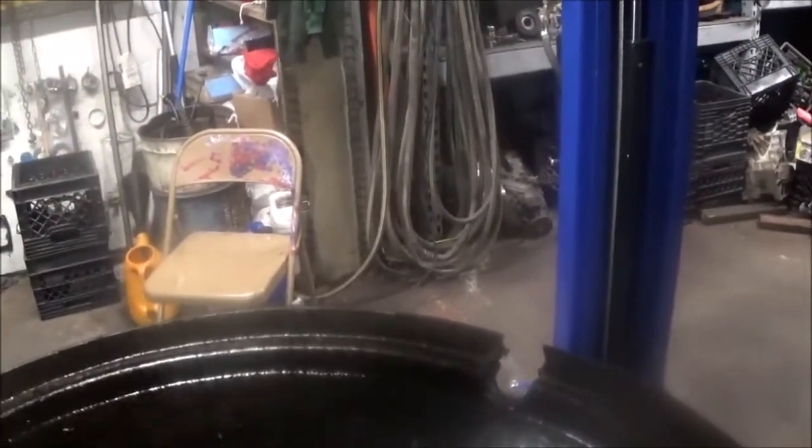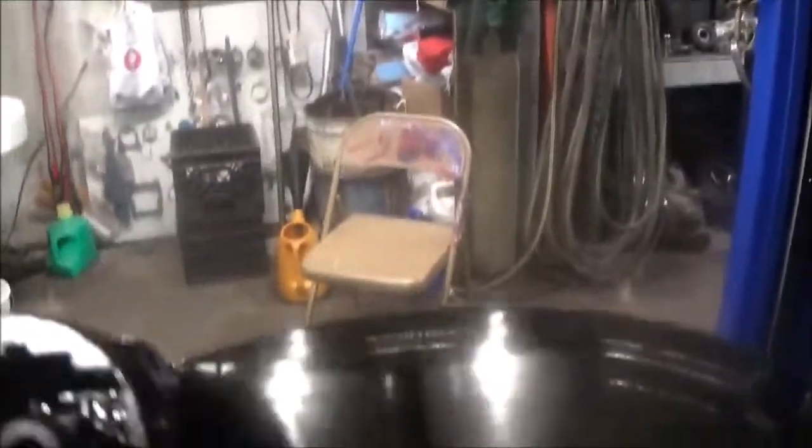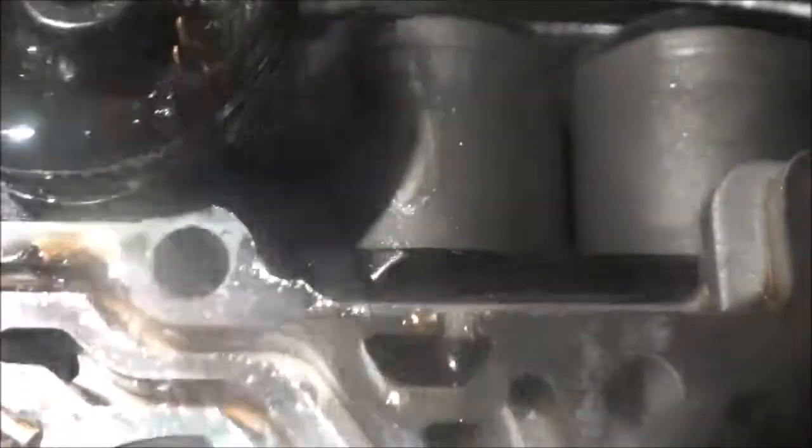In the connector here, we already had the pack out, so look at the pack. You can see in here, well, you could have seen, but oil ran into it. But it was corroded in there. Since I had it sitting under the transmission, that went away. But you can see pins missing in there. There's three, four on this side, and there's two missing inside. And on this side, it looks like one is missing there. Okay, but this was corroded, the oil dropped in it, so you can't see the green now.